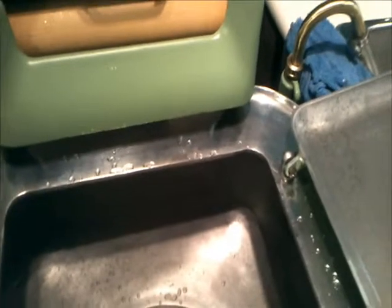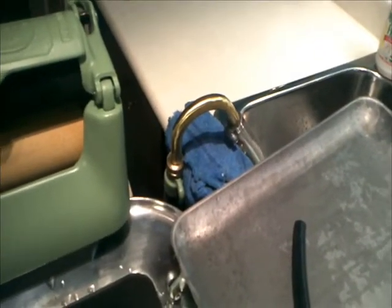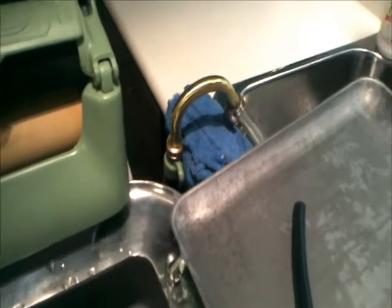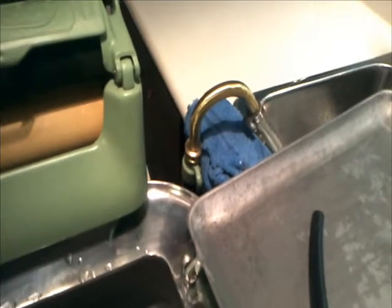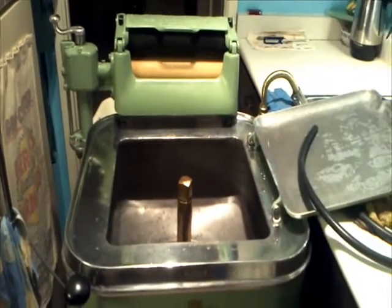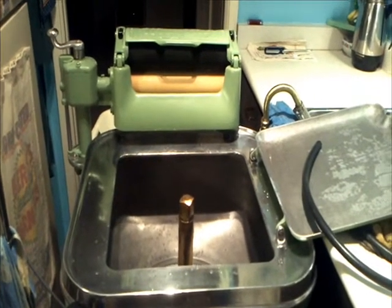One last thing: after the pump has finished, there's always a little bit of residual water in the pump mechanism — upwards of a cup or two. It's essential that you lower the hose into a little bucket or bowl to drain the last bit of water from the pump. That will help prevent corrosion of the pump. Hope it was helpful. If there are any questions, just address those on the YouTube site and I will respond.